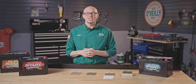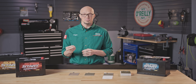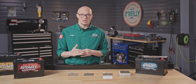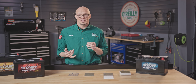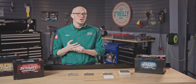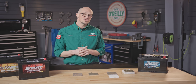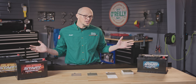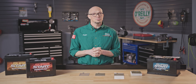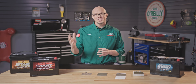To sum up, there are a few things to consider when it's time to replace your battery, starting with the manufacturer specifications for your vehicle. You can upgrade as much as you want but you never want to go down from there. Ways you can upgrade are to get batteries with greater cold cranking amps, greater reserve capacity, or in some cases upgrade from a conventional battery to an AGM battery like the SuperStart Platinum. All of these products are available at your local O'Reilly Auto Parts store. If you have any questions feel free to see a parts professional or reach out to us on social media — we'd love to hear from you. We'll see you again soon.